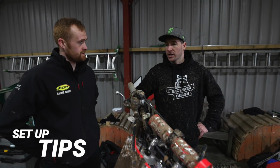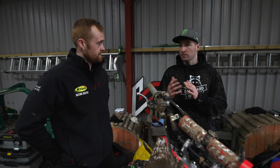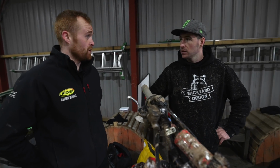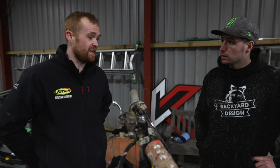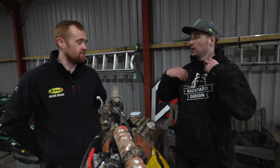If someone was to go to the track, any little tips that you would give them to start their day, or that they can work on, focus on during the day to help improve their bike? Yeah, certainly the first thing they want to look at is doing the sag. Get your sag set correctly. If you're unsure, either call us, check your owner's manual, and then once you've got your sag set, it's just a case of making sure that you've got everything adjusted correctly.